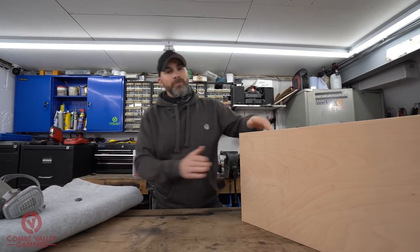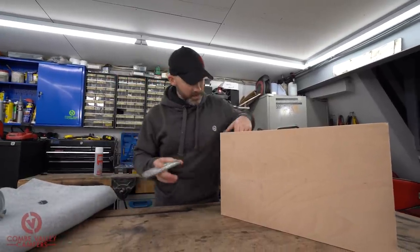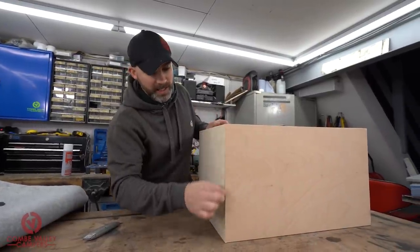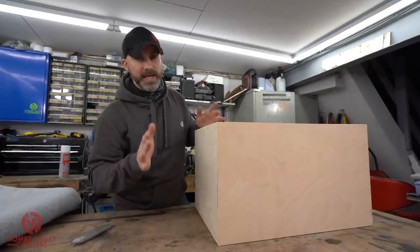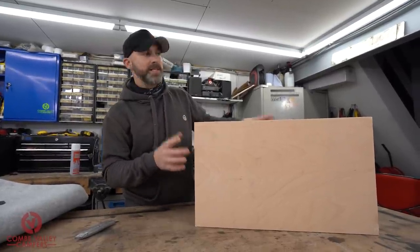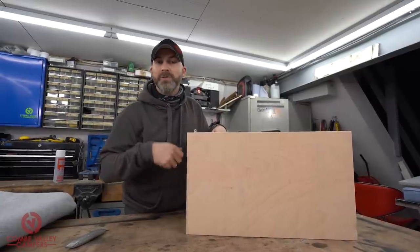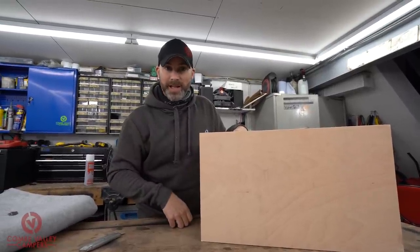What we're going to do with this one is wrap it up like a box but seamlessly so there are no nasty joints. To that end, we're going to start our carpeting on this corner. You might think that's a little bit daft because corners can grab, but it's going to be a lot cleaner to put an edge down on this corner rather than in the center. These boxes are going to be stationary most of the time in the van and you can always position the corner you want least affected into one edge of the interior.